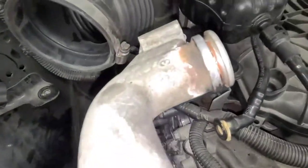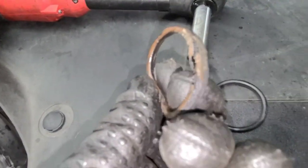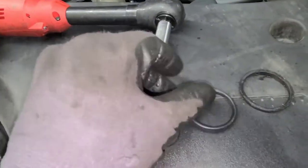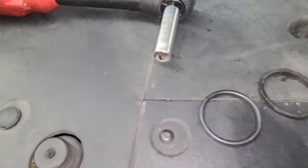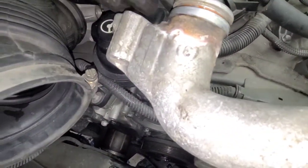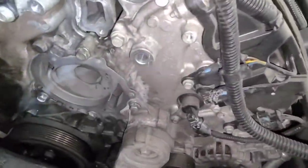I think I was able to find the right o-ring. I took it out — look how flat it is, and it's deteriorating. So I'm gonna go with this new one and just add a little bit of silicone on top of it to make sure it's not gonna leak. I'm gonna give this a little clean-up before I put that o-ring in, and then it should be ready.